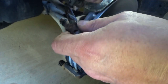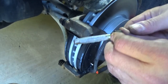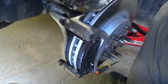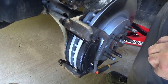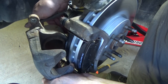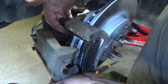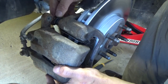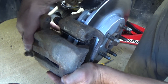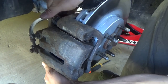I'm waiting for the rear brakes to show up — I think they'll show up today and if that happens I'll probably record that video. I appreciate the fact that people take the time to leave comments and make recommendations. At this point we shouldn't have to compress the caliper piston at all, or very much. You can actually put the piston against the back side of the brake pad and just kind of push on it. We took it off and didn't add any thickness — no new rotor, no new pads — so it should go right back on. You may need to push the caliper pins in to get the ears on by it.